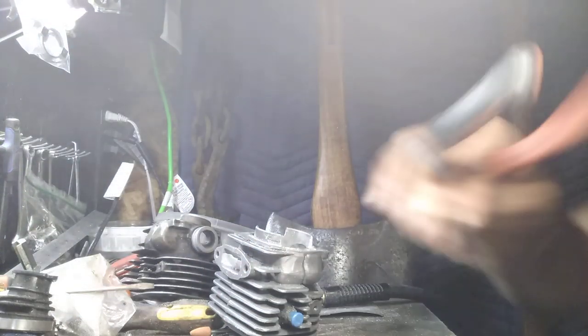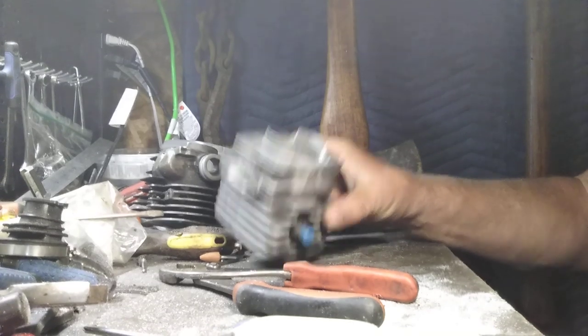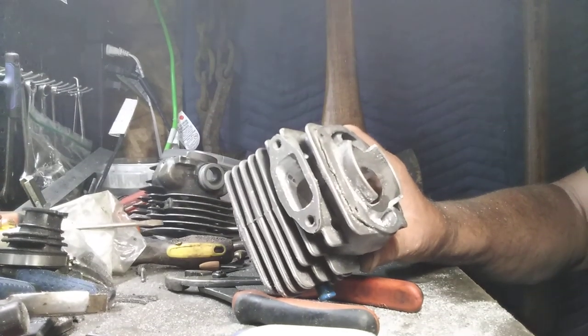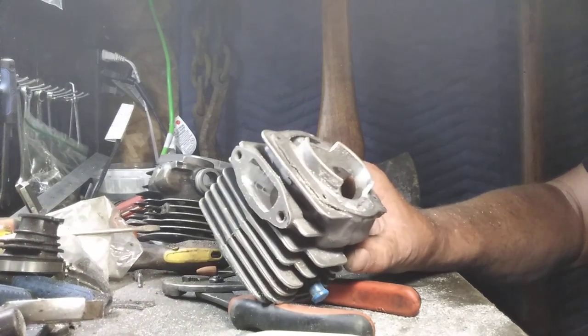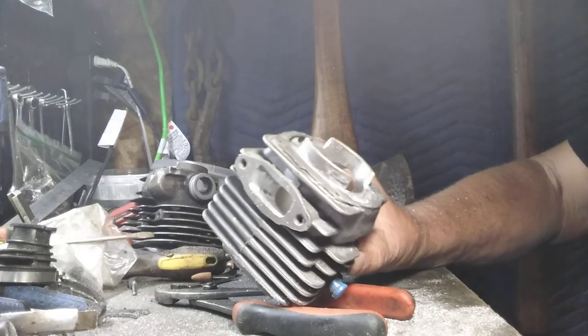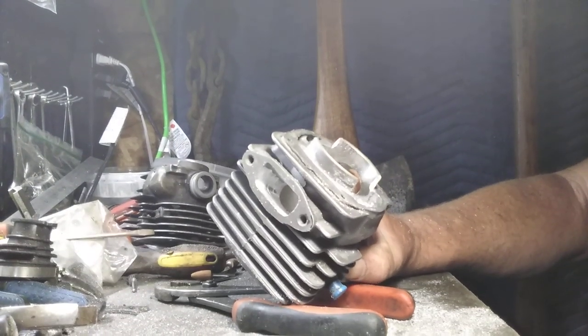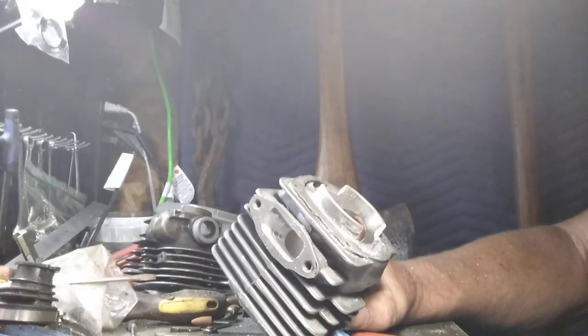It's pretty easy. Get yourself stable. A lot of times I'll just take a pair of pliers, lay them down, and I'll set that cylinder right on them pliers like that. And then I can rock that around, see? I don't need fancy jigs or anything. This is the way I've always done it. I've tried them movable vices. You guys are going to mention it. It's just too much old school to me.